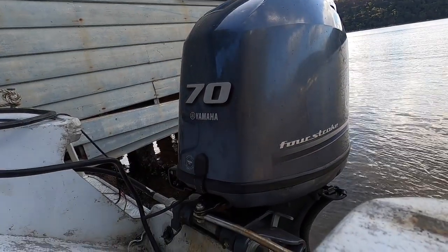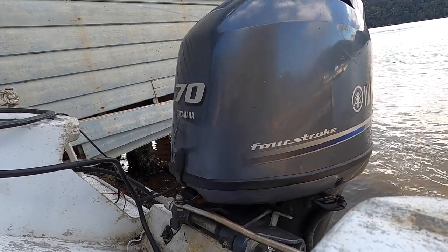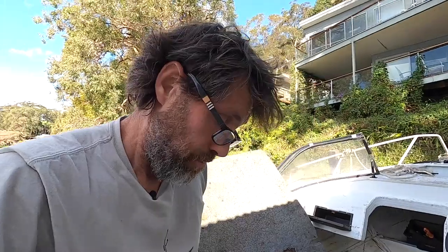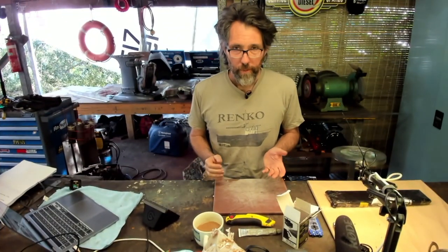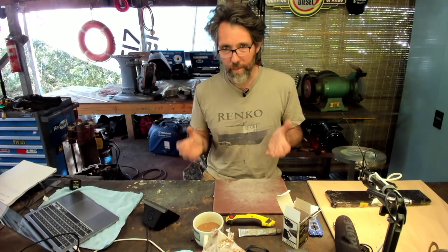Let's turn the wheel to see what it feels like. Not too bad. The helm sounds a little crunchy — it has been underwater. But if down the track that gets replaced, not a huge job. Basically, take the cable out the same way we took it out before, three bolts, new helm, away you go. As you can see, it's a pretty straightforward process. There are subtle differences, like dust seals on the end of the tilt tube on some outboards, a different mechanism for locking the cable into the helm — that kind of thing. But fundamentally, that's the process.